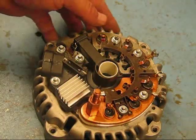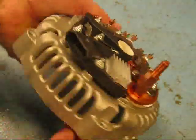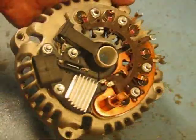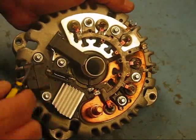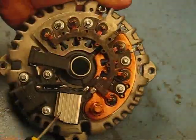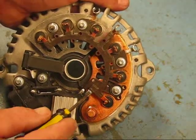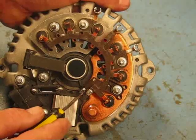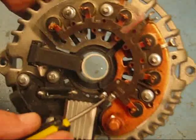Now to change this regulator, the standard four-prong plug type voltage regulator is held on with three screws — here, here, and here. You want to take those three screws out to take it off. The key point to note is that this voltage regulator plugs into the bridge rectifier at two points: a lower point down here and an upper two little terminals right there.